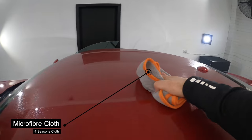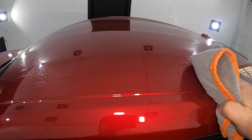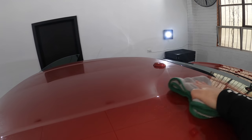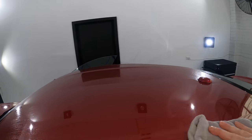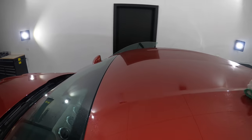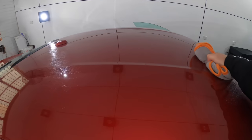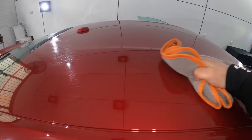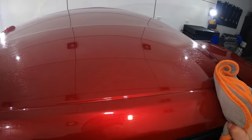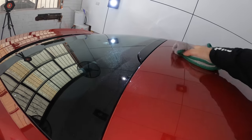Now basically, an IPA panel wipe product is an isopropyl alcohol dilution mix that's used in this step to remove things like detergent or chemical residue, as well as any minor streaks, dust and dirt that will be left over after a decontamination process. This product should be liberally sprayed on panel by panel, wiped over and into each panel with a first microfiber cloth and then buffed off streak-free with a second cloth. It should be used over the entire surface of the vehicle, including all the glass, trims and door jambs, and if done right, it should take you a good half hour to do it properly.